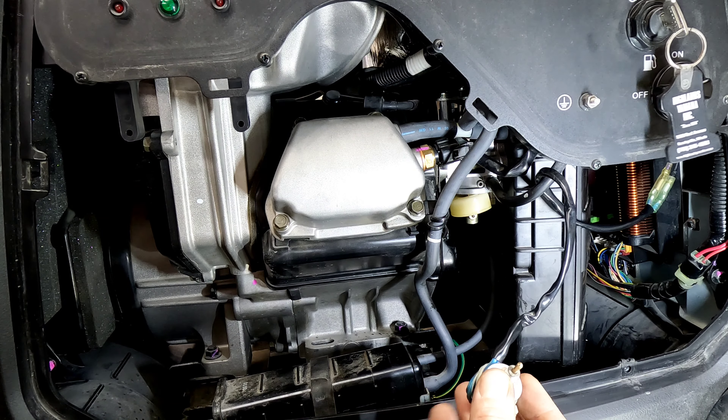It just runs perfectly now. Well, there you have it. Something as simple as an emulsion tube not being completely cleaned or an afterfire solenoid being stuck can cause an issue like this very easily and cause it not to run right. Hopefully this has helped you get your generator back into working condition. Now at least he can get this thing back down to Florida to help them out during the hurricane cleanup. Thanks so much for watching - hit that like and subscribe button if you enjoyed the content.